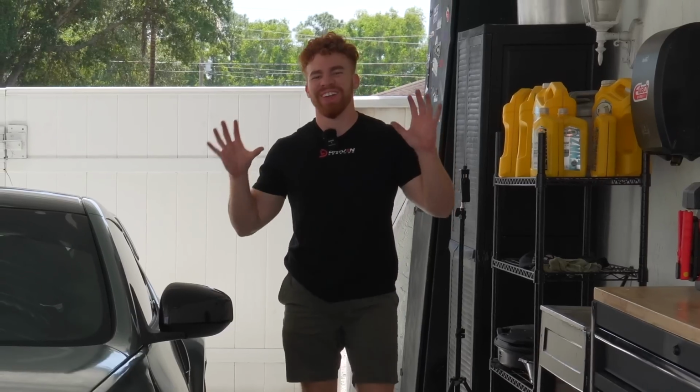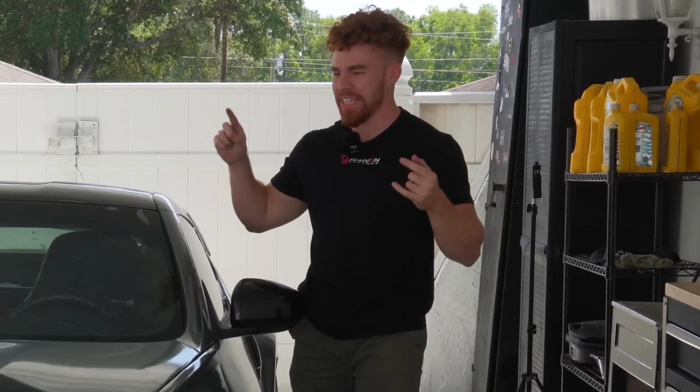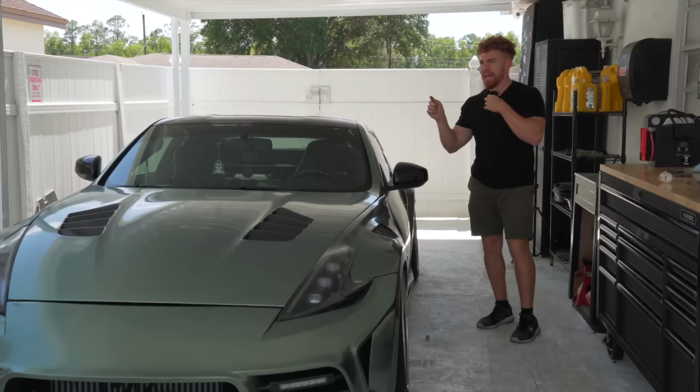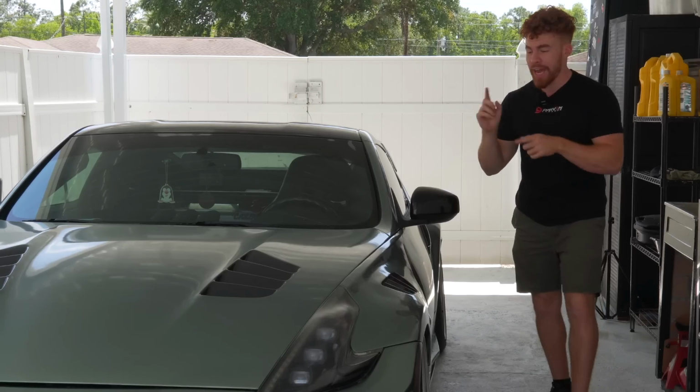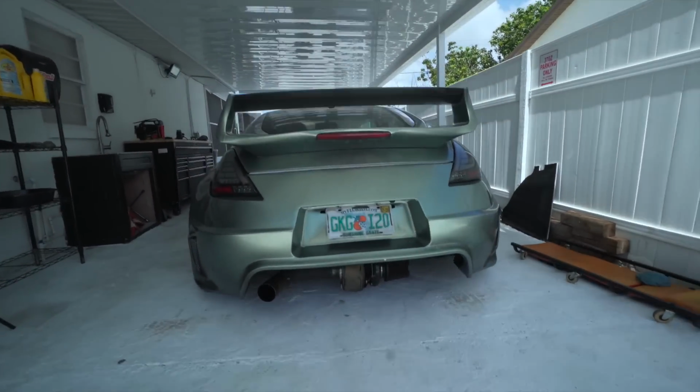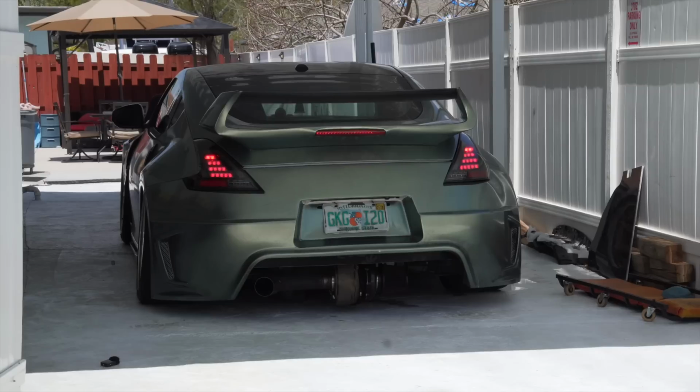What's good, baby? Finally, we're gonna go ahead and drive the 370Z. We also did go ahead and change the duty cycle to, I believe, 52%. So right now, we should be like at 16 or 15 and a half, 16 pounds of boost. We gotta keep an eye on that as we're boosting in streets. First cold start on E85. Oh, this is so exciting. And funny enough, we also do have to go ahead and fill up the car with E85. So that's gonna be another exciting run.